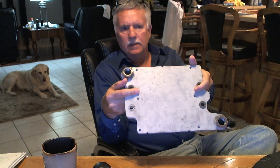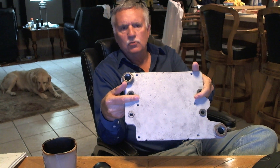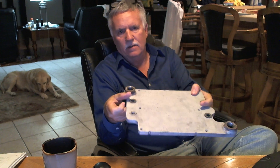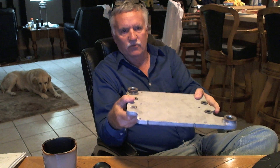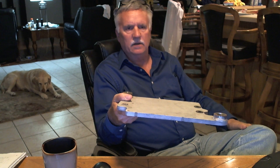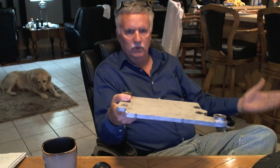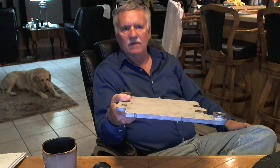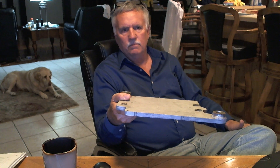This is a typical cooler plate. They do make two cooler plates, and not quite what you might think. Usually there's a difference between Select and Select Plus, but on cooler plates, the difference is N14 Select and Select Plus all take one cooler plate, and L10 and M11 Select and Select Plus all take another cooler plate.